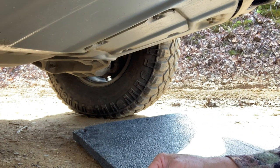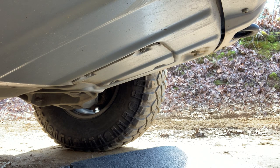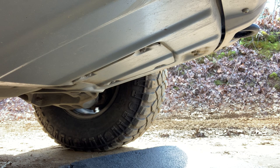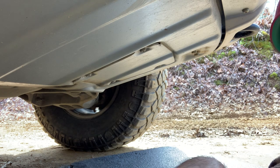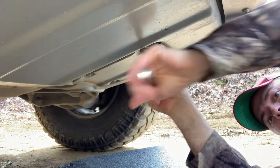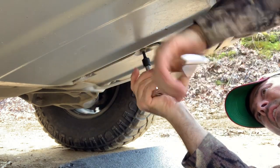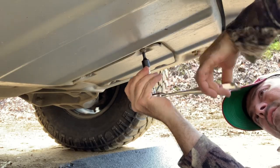While you're waiting for the oil to drain, swap out your five-eighths socket for your T40 Torx bit. I like to use a two-and-a-half inch extension on that. Go ahead and take out these four bolts on the skid pan.